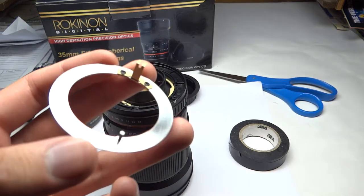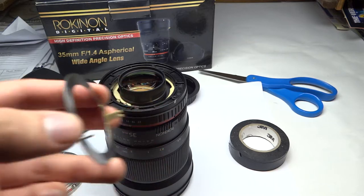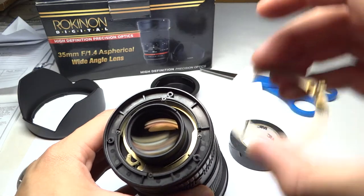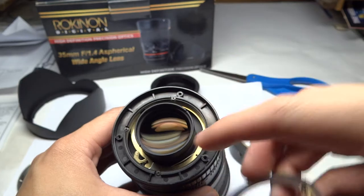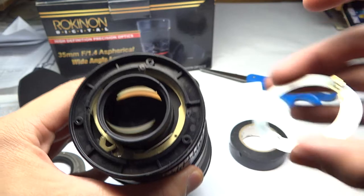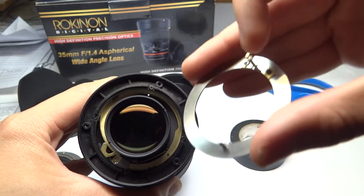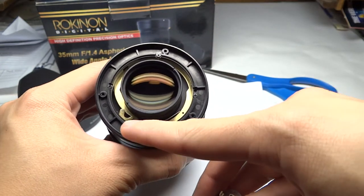You'll notice that once you remove the ring, this is what holds the lever in, and I will show you that right now. This pin right here at the edge — I'm not sure if you can see that — this pin has to go on the outside of this lens right here when you're reassembling it. The pin that protrudes from right here has to go in between this, and then this left pin has to go on the left side of this lens.